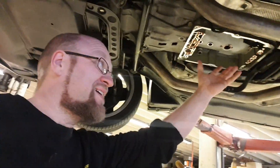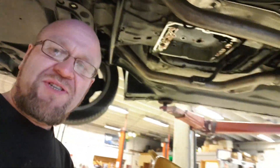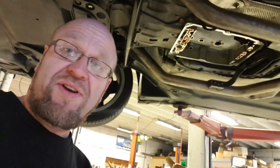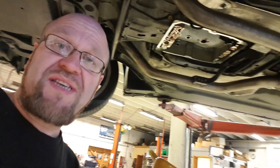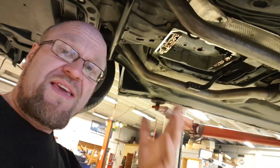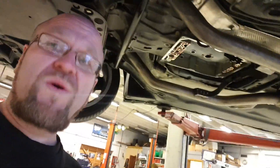As you can see here, it's all about the transmission. This time around, I have done some previous work to the transmission. I replaced the oil and filter, and I also replaced some of the overlap valves inside the valve body and a spring that can break on these 722.6 transmissions. The transmission has worked perfectly since that day.